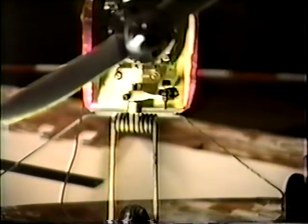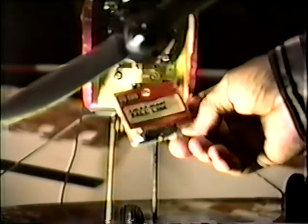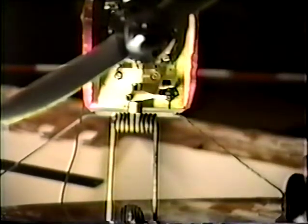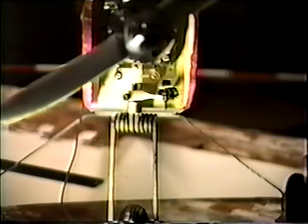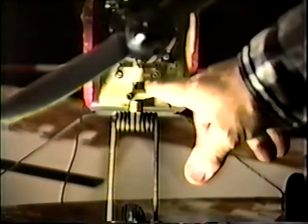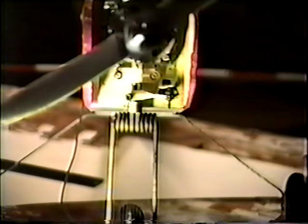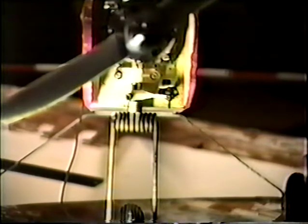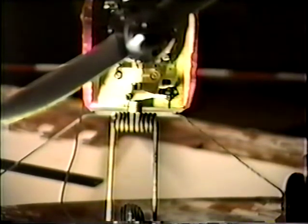Now, one of the reasons also that I've got that big hole in there: this adjustable ball link here is kind of large and flat back there on the back, and if you have just a little hole, that thing could catch on the edge of the hole and cause you a problem. So I've just made sure that the hole was big enough that it couldn't catch. And you see that smaller hole up above there, that's where the original throttle cable was supposed to come through. But the old nose wheel, of course, had a different arm on it and a little bit different arrangement. So I had to move that hole lower, and I've just left the holes there. I considered plugging them up, but I haven't yet, and I guess I should, but I fuel proofed everything good. And so far as I know, we've not had anything much going back in there.